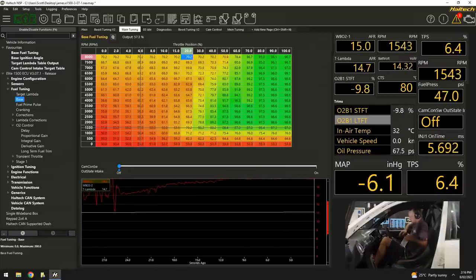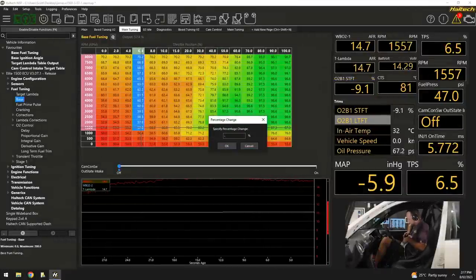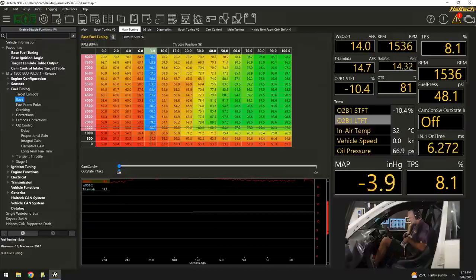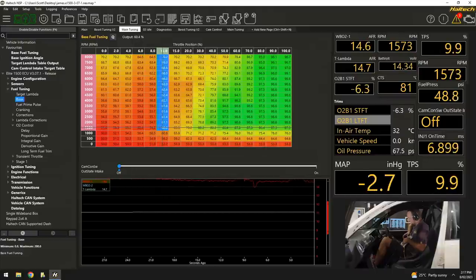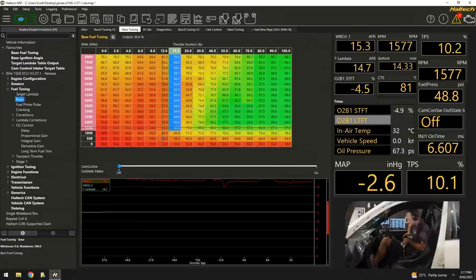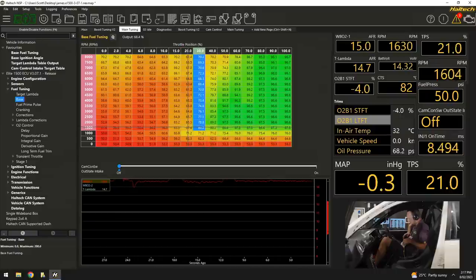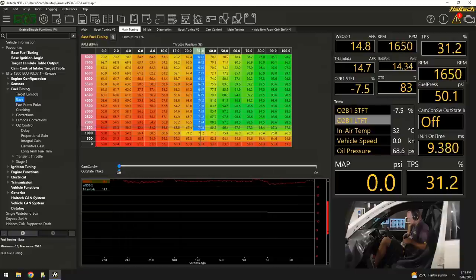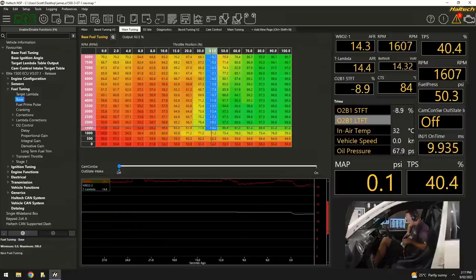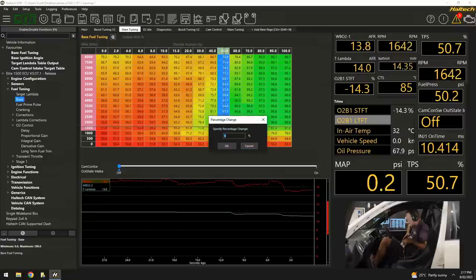Okay, 1500 RPM, short-term trim is pulling out 10% in that cell right there. So I'm going to go P percentage minus whatever it says, 8. Next cell, 8%. P percentage minus 8. I'm going to do the whole row because I've simply roughed that in. I don't really know what's there. Minus 7. 15%. Probably about 5%. I'm going to leave that because that's probably within the O2 trim, so we'll fix that up. Minus 3, 4 there. 30%. Minus 3. I'm going to try and get us to about minus 5 everywhere. 40%, minus 5% there, 50%, okay, pretty rich over there, minus 10%,